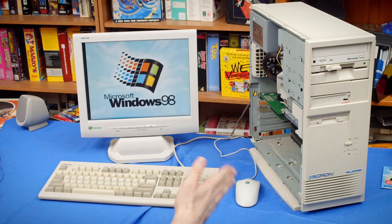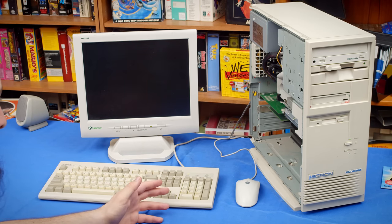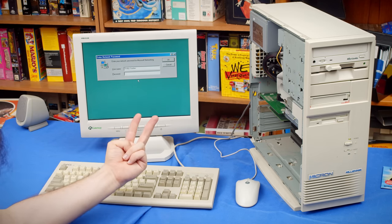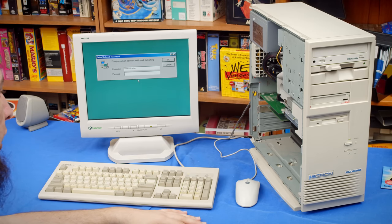Now, this is the Western Digital Caviar drive that I had put in there originally, and you can see it's clearly working. I spent so much time troubleshooting issues with this. I tried changing all of the settings in the BIOS. I tried swapping over to a PCI IDE controller. I changed through multiple drives. Nothing would work. I got to the point where I was out of ideas and I posted on my Pleroma instance to see if anyone had any ideas what the problem could be.